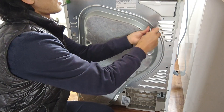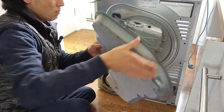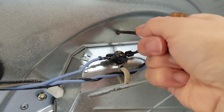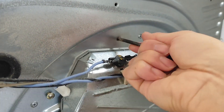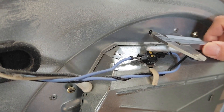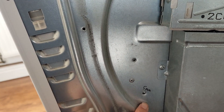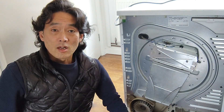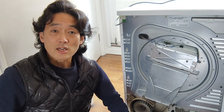So I do the opposite idea: to increase the intake hole, to make the process of humid air going outside of this drum quicker. Remove the back panel again to access the holes. The current intake hole diameter is 3mm, so the idea is to increase from 3mm to 5mm by drilling. I made three holes bigger and removed the screws I used for closing them. So I made three holes bigger out of eight. Let's put it back and see how it goes.